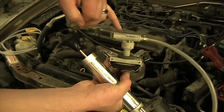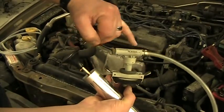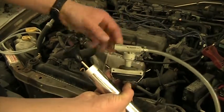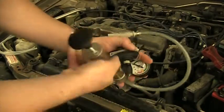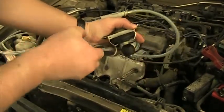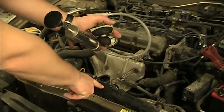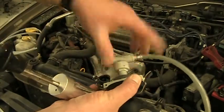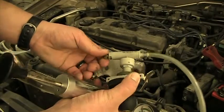There are two ways to slide this tool. You can slide it to pressurize the system, or you can slide it over to pressurize the bladder. Just to show you what happens — when I go to pressurize it, you'll see that little balloon fill up. This is what's going to seal inside the radiator neck to allow us to build pressure. That's what's really happening when we pressurize the bladder.